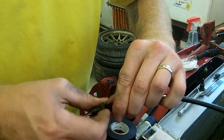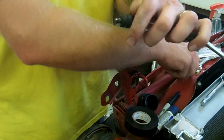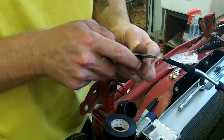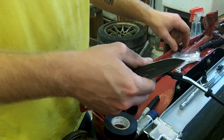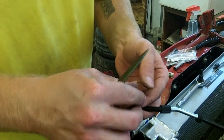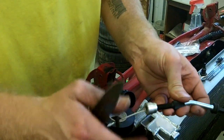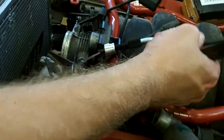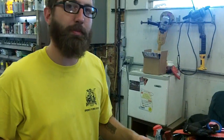Or we'll just cut it — I like cutting it. That bit unscrews. This is when Nate cuts his fingers off. This piece just slides over the cable, it's going to screw on like so, and it has a little circlip that once you get it through your bracket, it'll go on the back side. I'll show you what it all looks like whenever it's fully installed and adjusted up.